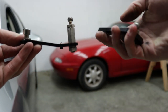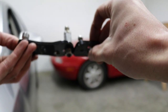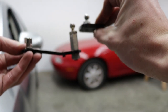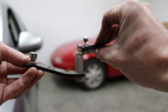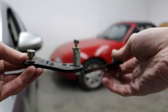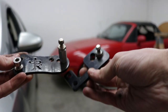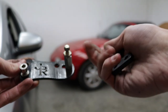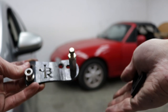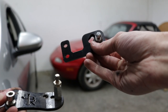Here's the JBR plate — as you guys can see, this sits up really high. And if you guys take a look at this one, the Torque Solutions plate sits really low. This is what I'm talking about — because it sits higher, your positioning is different and it's a little bit more harder on the transmission forks. The JBR also has adjustment, but same thing — it's going to sit higher and it's not really going to do any good to your transmission.